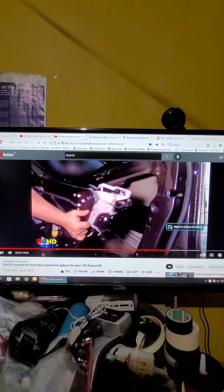So some people even say the manual say don't put the pin back. Very strange. Okay, but if you don't put it back, minimum you need to cable tie it better. It will make noise, especially when you're closing the door. If you own one of the car and you did one of the model and you did the door lock or window panel before, then try to close your door, see if it hears any noise. If you hear noise, that means that this is hitting the carry panel. So if you don't like the noise, you may need to take it out to fix it. Or if you don't know how to take everything out, just after you take the outlet panel off, you just cable tie it. They will stop the noise.